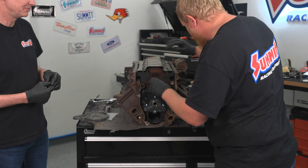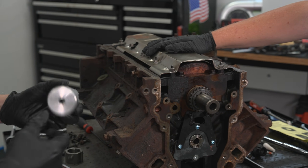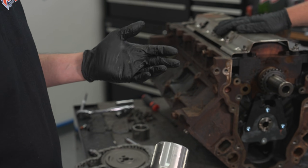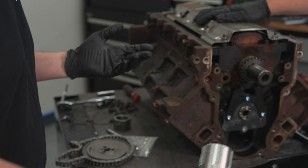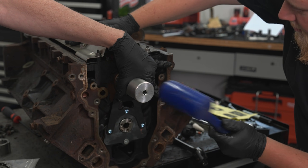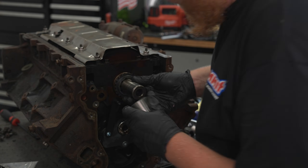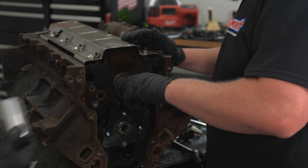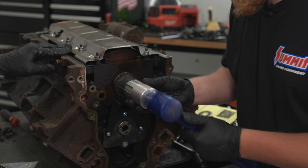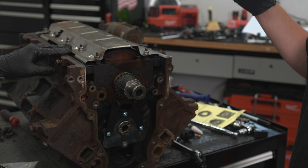I've got that on there, slides nice on. I'm going to grab a rubber mallet and knock this on. What we're going to use instead is actually a Summit oil pump primer - it's designed to prime the engine prior to startup, but it also works really good going over the snout and giving it a few love taps. Solid - nice and bottomed out. We can go ahead and throw our oil pump drive on, grab our primer tool again. Next thing up is going to be oil pump pickup and oil pan.